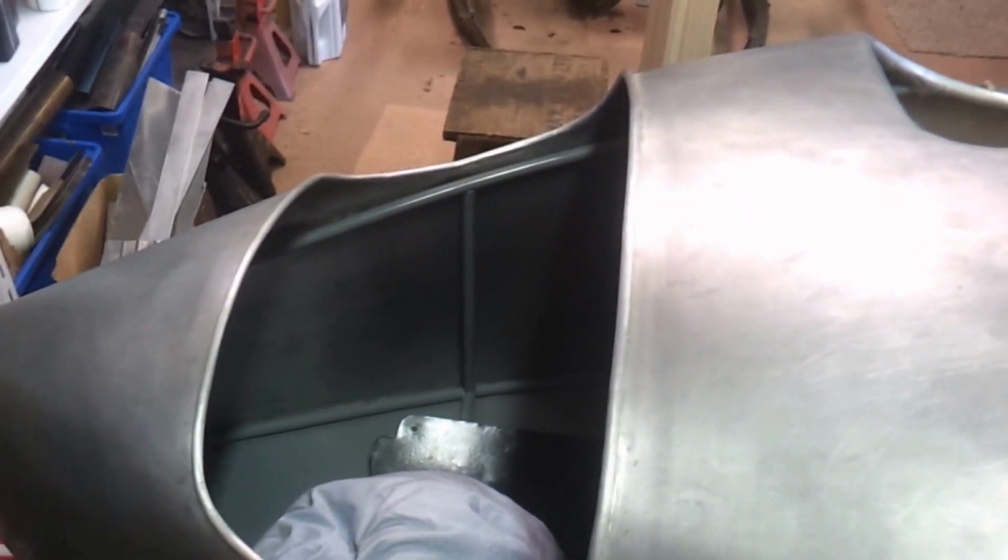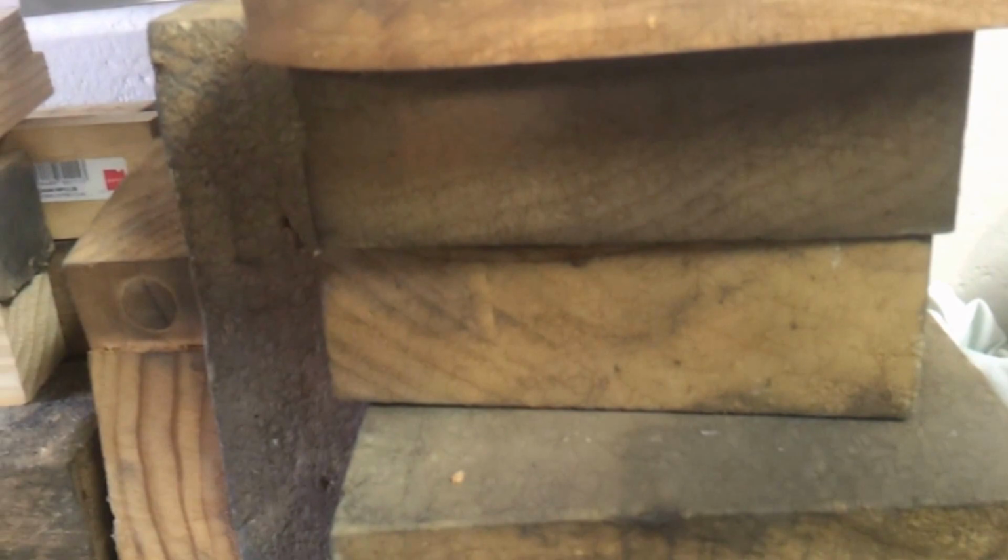This piece of aluminium is one I did on the English wheel, so I was just practicing, just rolling curve into the panel. So that's how I managed to put curve into the panels on the Austin. So when I make the panel that covers the boot, the boot lid, that'll have shape rolled into it like that. Not as much as that, but shape.